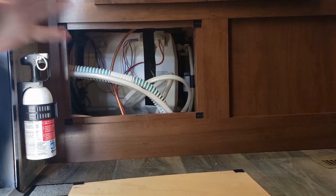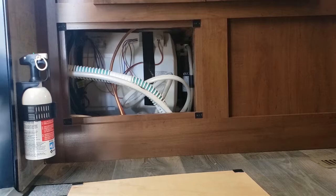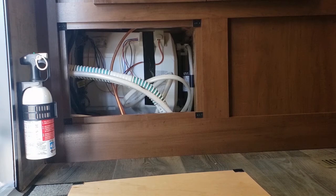After we've drained the water heater, water lines, and water tank, we can bypass the water heater, bring our hose out, flip the handle, turn the pump on, and go to the faucets to purge antifreeze through the system. In the spring, you just put water in and flush it out. Around Washington, most people just drain and blow it out.